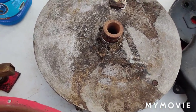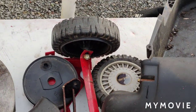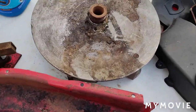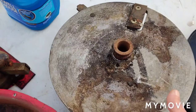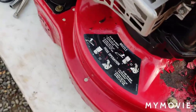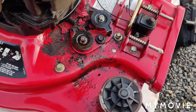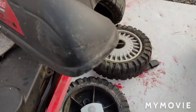So I had to disassemble everything. First I had to take this cover off; before that I had to take all the wheels off and everything. Then I got to this point where I had to take this metal shroud down to gain access to the auger assembly — or mulcher assembly, whatever you want to call it. And I also had to drop the transmission out of it in order to get the cover off. So more or less I had to take the whole thing apart — everything has to come off on this.